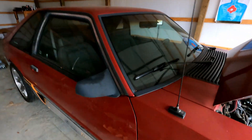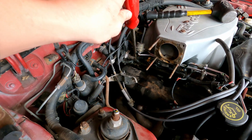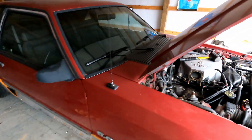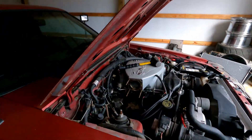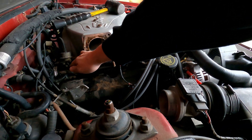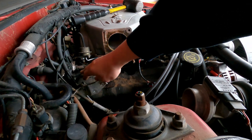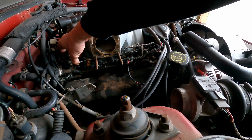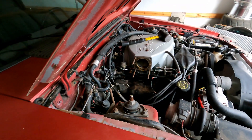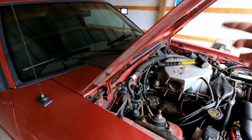What I've done — not the right way, but I just pried up a little bit on the fuel rail to give it a different angle. All you really need to get the fuel pressure regulator off is a 4mm allen wrench. There are three bolts underneath; the front two are pretty easy, but the third one is too close to the heater core pipe. If you bend the fuel line just a smidge, you can get an allen wrench on it and start turning. All I've got to do is loosen all three, disconnect the vacuum line, and put the new one on.